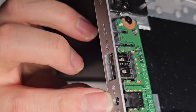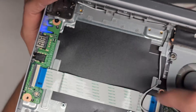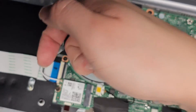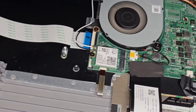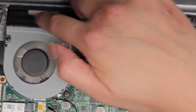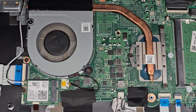You can see there's the USB port here and the headphone jack — that 3.5 millimeter jack — which is on its own separate board. It has a little flip latch that you can flip and then pull out. Wireless card is here with the antennas. To remove the antennas, you go from the tail and pull straight up. Here you have the CPU, which is soldered to the motherboard, and then you have the heat sink going over here to cool it down.